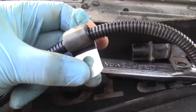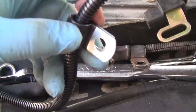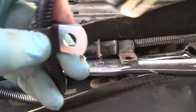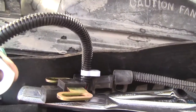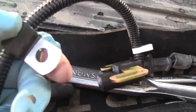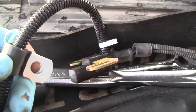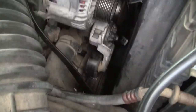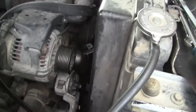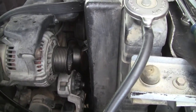One improvement I found on the new one: the lower clamp's lower strain relief has a fully rounded edge, which matters because when you're rotating the sensor to get that bolt out, it helps a lot. The old one has square ends and didn't want to rotate. Also, take the belt completely clear out of your way — all the way down — it just makes things easier. With the loose fan and unsprung tensioner, the new one bolted in. I taped the feeler gauges, stuck them in, and forced the sensor down with a screwdriver while tightening the left nut.